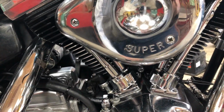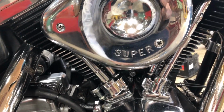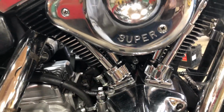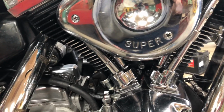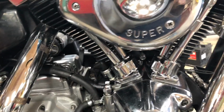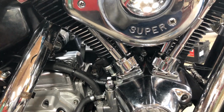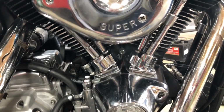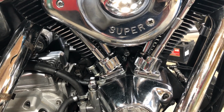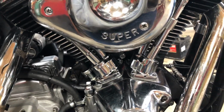No, the motor sounds really good, nice and tight. Unbelievable what the difference of 5 flats out of 6 on the adjusting nuts made. About 23 thou difference in stroke on that lifter. Quieted it right up. And you know what? That's probably what was the matter with the S&S lifters when I had them in there as well. Although the S&S lifters started out nice and quiet, and then they got noisy when it got warmed up. So this thing sounds nice and tight and strong, and I can't wait to take it for a spin.